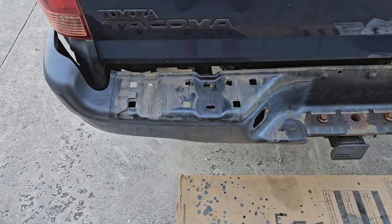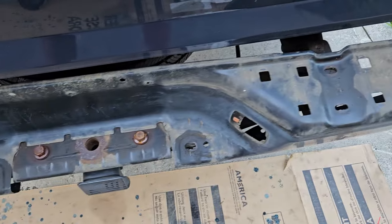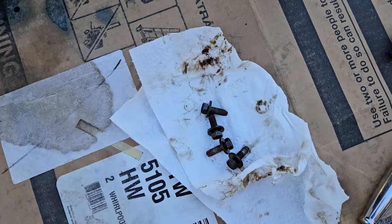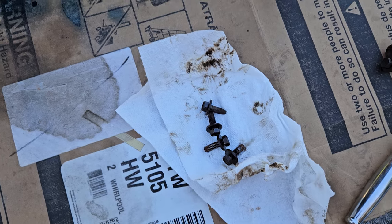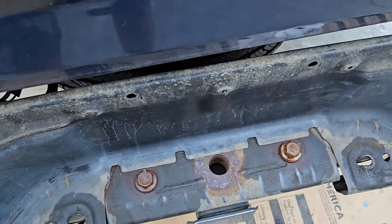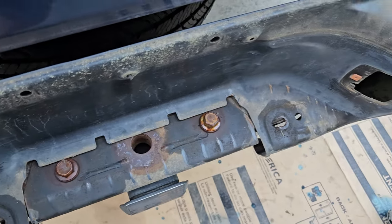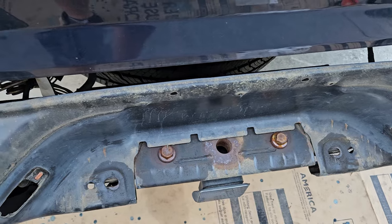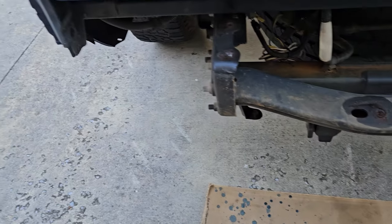Alright, it's cooled off a little bit, and the penetrating oil has seeped in. Six bolts on top, all 12-millimeter. Four bolts total on the bottom — had to be very careful with those, one was squealing and screaming the whole way. You do not have to take off the two large bolts here, because this thing will pop right off. You need two hands, but it will come right out once everything is loose — just work it out gently. Bumper's off.